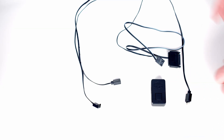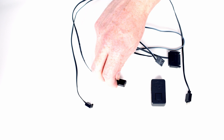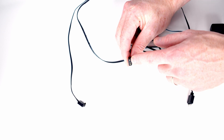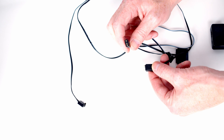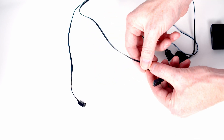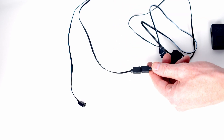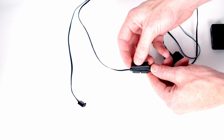Using the controller to manage RGB, we first connect the ARGB connector from the pump head to the supplied cable. Note the little arrow on one side — there are three pins on the bottom: two pins together, a space, then one pin. The cable matches that same pattern. Line up the two five-volt pins using the arrows and push the cables together until they click. Cooler Master supplies a little cover to hold the cables in place and prevent them from coming loose — slip that over the top.